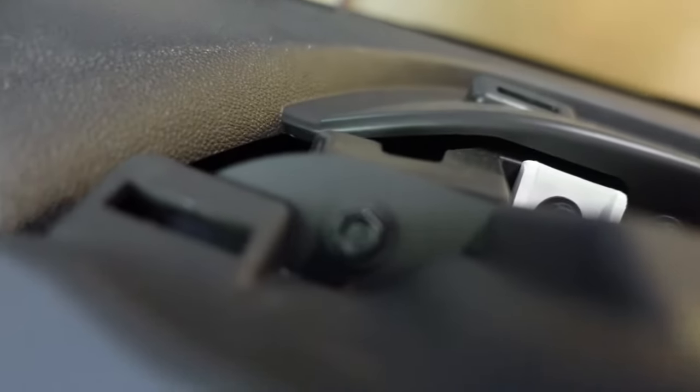I've got the wire installed into pin 20 — you can see that big green wire coming down, locked into place. It can only go in one way; you want the locking tab on that silver terminal to face out, like all the other ones in there. Now I can put this connector back together. I'm going to route this wire down behind the dash and bring it up to the connector on the back of the clock spring for the similar install on the other end.